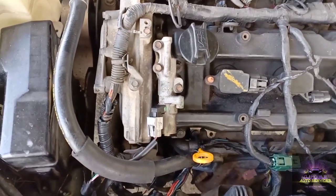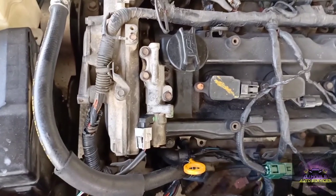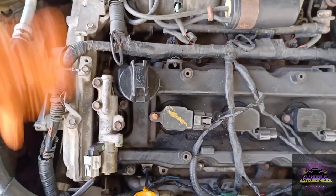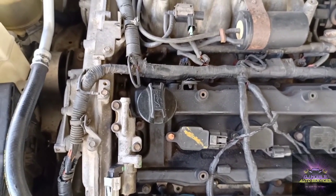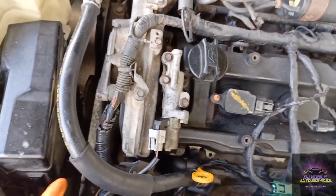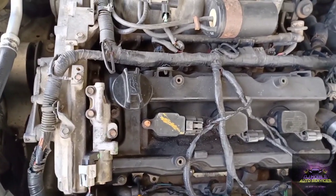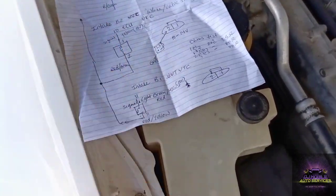So what we're going to do is check our connections, address whatever wiring issue they've got here, and replace this connector jack to make sure it makes proper contact inside. Good thing about this vehicle having two banks — I can compare what I got on number one versus number two. The customer already replaced the solenoid unit, so I'm going to do a test on the old one, which I believe is still good. They didn't catch this little connector issue. This is why I always tell my techs to be very observant when vehicles come in — don't rush to change parts. Pay attention to these little details; it saves headaches and saves the customer money.